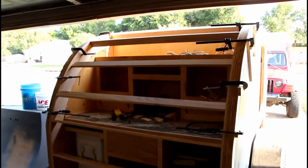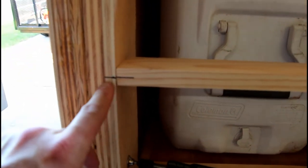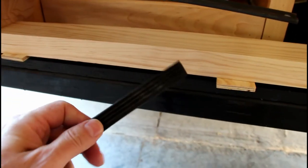I have my spars temporarily installed. I've marked off the middle of each spar, so all I have to do is line up the line on each side — that helps get everything nice and square so the hatch won't be crooked. I've also taken a piece of quarter-inch plywood and put it underneath the bottom spars. This gives room for the seal to compress properly on the bottom spar, because you don't want to over-compress the seals or you'll have leaks.